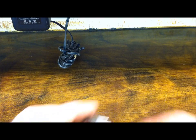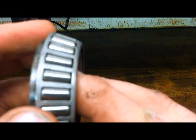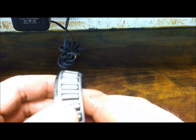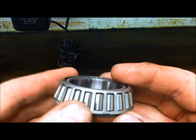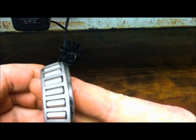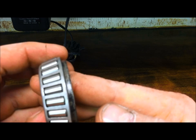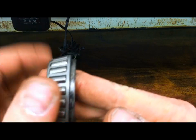Got the bearings all cleaned up. Here's the back bearing — see how it's nice and shiny. It's got a little wear to it, it's not rolling quite as nice as it should, but you can see there's no pitting — nothing really wrong with the rollers. There's minimal movement. I'm going to replace all the bearings anyway, but if all of them moved like this and they looked good, I would leave them in and maybe replace them next year.